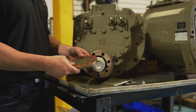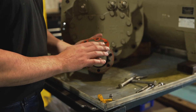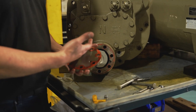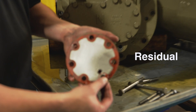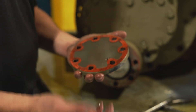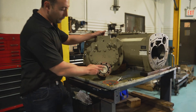You'll see the plate has the gasket stuck on it. Like I always say in most of our videos, if you're removing something that has a gasket on it, you want to make sure you remove that and clean it before you put the new gasket on. You might have to scrape it off because they do sometimes really stick on. This one is leaving residue, and you want to make sure you get all of that off, because if you don't, when you put the new gasket on it can help facilitate a leak.